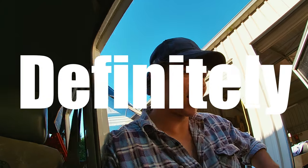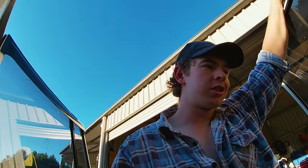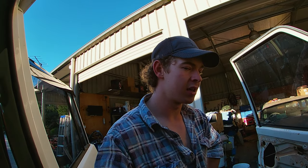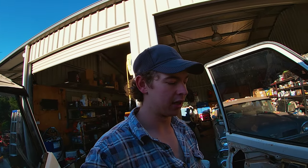The Maverick is definitely a bit of a mess right now — door cards off, camping gear in the back, screwdrivers and screws everywhere. While I'm waiting for some parts for some other important mods, the radio died a couple of trips ago, so I decided to replace it with a secondhand one my uncle had lying around. It's a Pioneer with Bluetooth, which is a step up. I'll probably replace it in the next 12 months, but it was a quick, easy, cheap fix. When I put it in it worked, but then it played music for a little bit and cut out, which suggested to me there was a short somewhere.